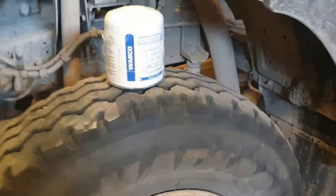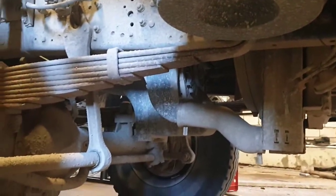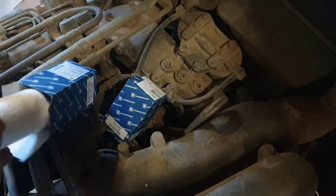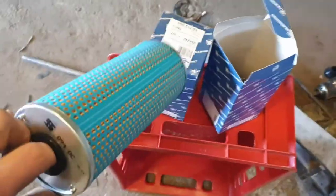Today we are going to be servicing a Mercedes-Benz 1824 truck. We are changing quite a few things. This is an air dryer which separates water from the air system — it is located on the driver's side. We will also be changing the air filter, located on the passenger side under the truck cabin, secured with a 17mm nut from underneath. The fuel filters are located on the engine top under the truck cabin, and the oil filters are on the left engine side, right behind the driver's side front wheel.